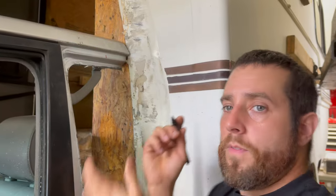We're gonna go ahead and start trimming the body back until it fits. It's gonna be trim, trim, trim, trim. This way we don't overshoot it. So let's cut a couple inches off this thing. Okay, we're 3 inches off of the door, which we can trust is good and straight. Truck's never been wrecked, which means it's gonna be 8 inches off of my remainder of the cap. So let's go ahead and cut 8 inches off it.